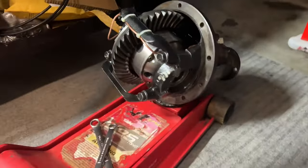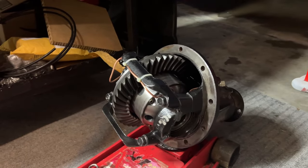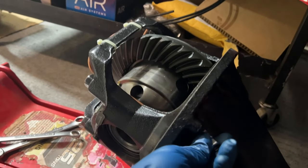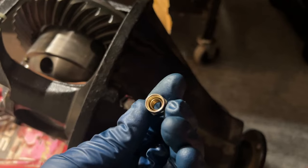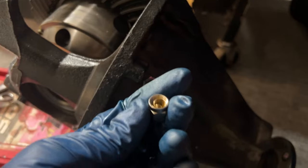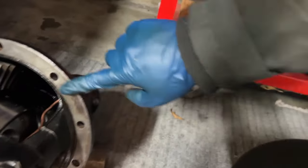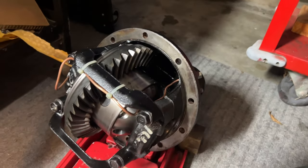We're going to put in the differential running at nine to eight thousandths backlash. I realized I messed up the ferrule — the little gold cap, when you tighten it, bites down on the wire via a cone shape inside. I've got a new one and I'll be installing it now. I'm also going to RTV the differential here since it's easier to RTV the third member than to do it on the car upside down.